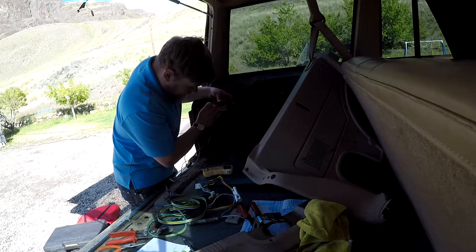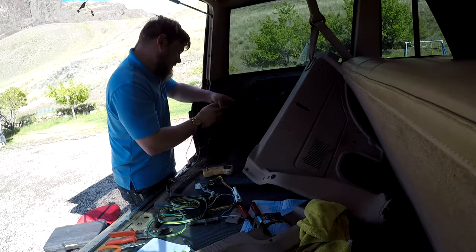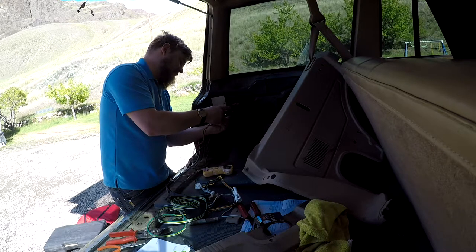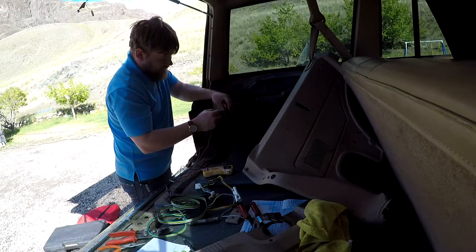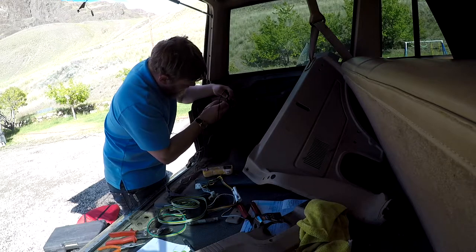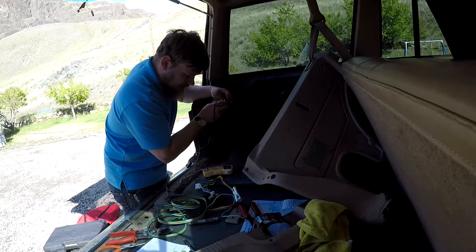Not that one. Yeah. Interesting. Your voltage meter might pick up that it turns on and off with the blinker. Yeah, I know. But I got a single green one here. That's saying it's a turn signal. I'm wondering if the green is its own separate ground for the turn signal. It's getting the right connection. Alright, let's try this one. This one? Okay, what the hell?